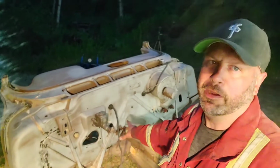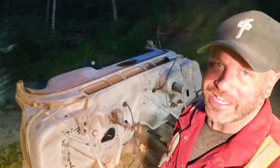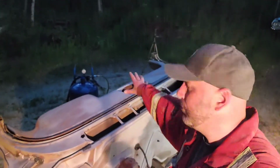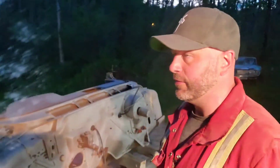All right, cool guys. So I got most of the Firewall sandblasted up with a 20-gallon unit. That thing works really good, man. I'm telling you, really good. As you can see right here, this is 2 bags of 3060 crushed glass, and then I ran out of that. Put in some of the regular sand. The regular sand is kind of clogging up the gun. I got these bigger chunks of rocks that keep clogging up the tips there.